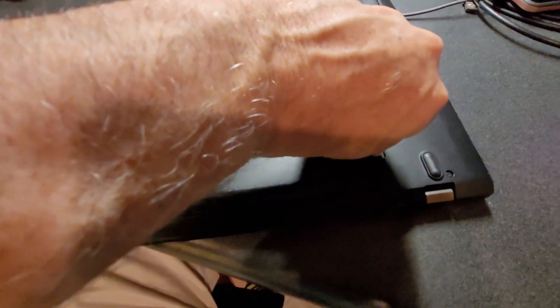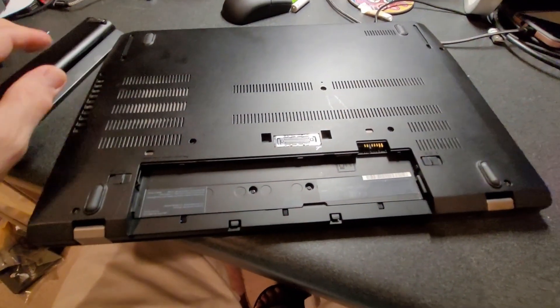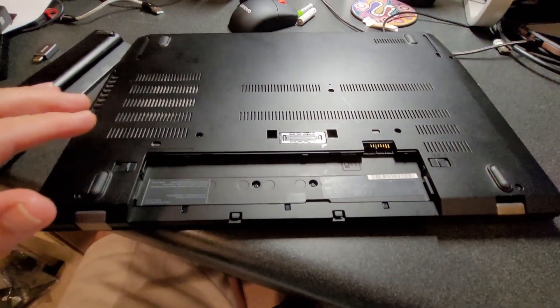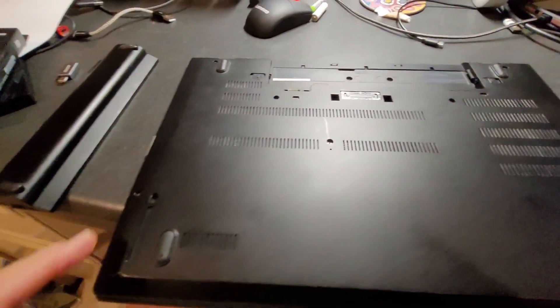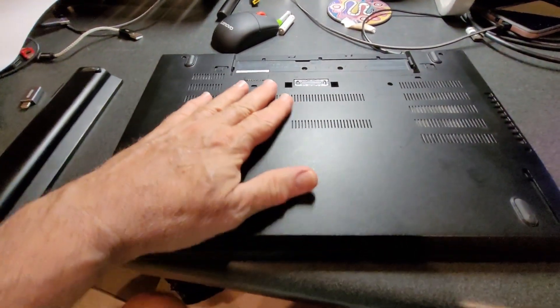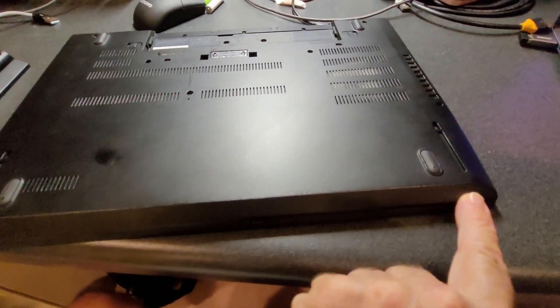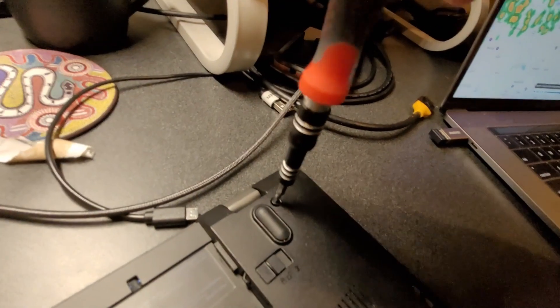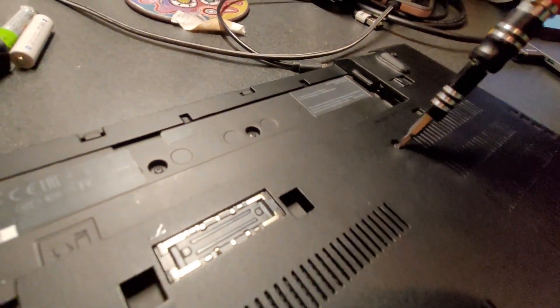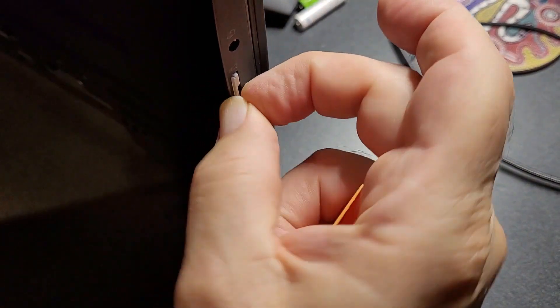The system should shut off. I'm going to take out the external battery and slide it out. Now we're going to disassemble the bottom plate — looks like seven screws to take out. Then we'll need a little tool to help separate the clips around the edge. I've taken this laptop apart a few times; the screws don't pop all the way out, they just stick in there. Be gentle so you don't strip them. Let's pull out this card reader.